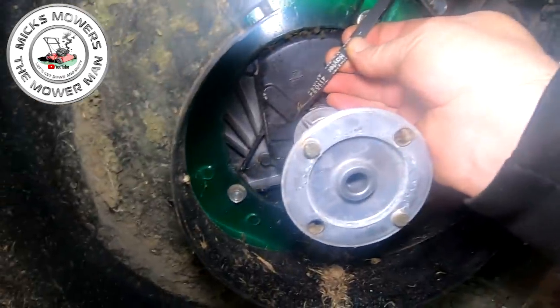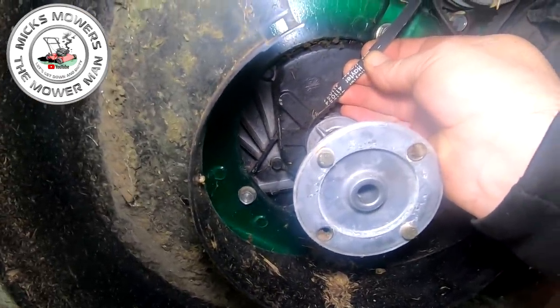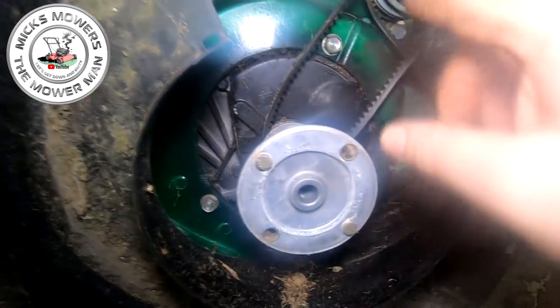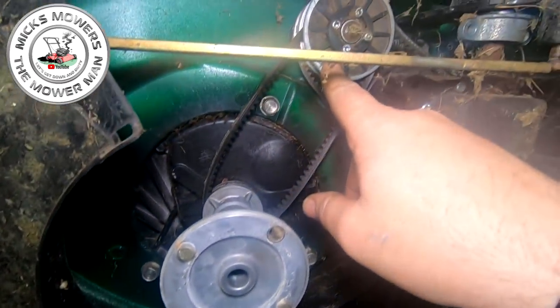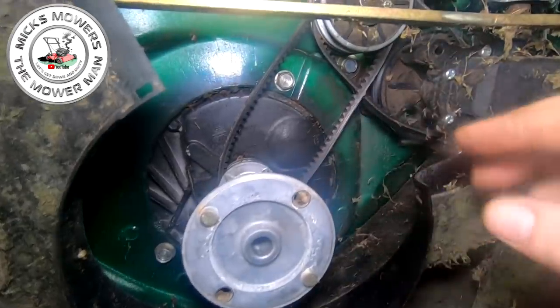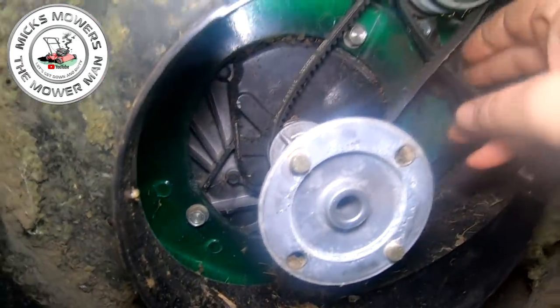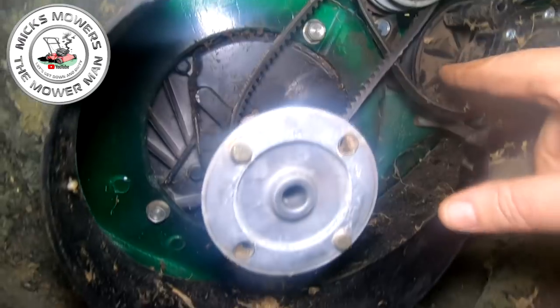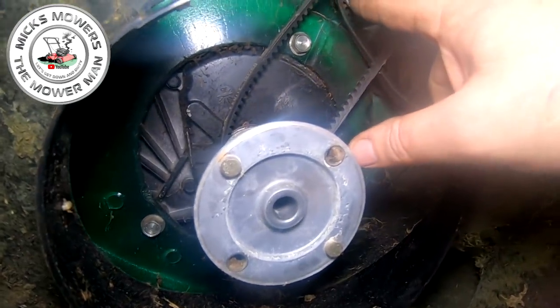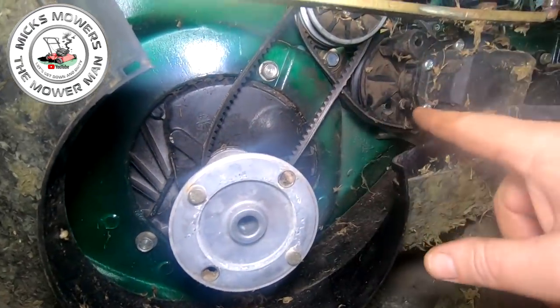There will be a number on these belts that tell which one goes where. The 411024 is the drive to variator bottom pulley, okay? So, crankshaft to variator bottom. And that would mean that the 25 belt, which is this one here, one behind, that goes gearbox top variator, okay? Just make sure you get the orientation correct. So, crankshaft to bottom, gearbox to top.